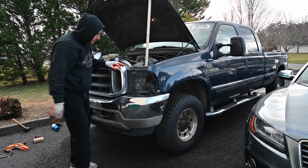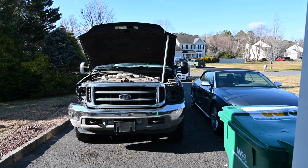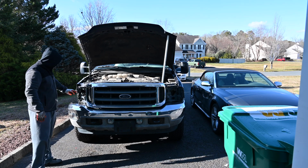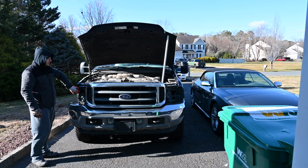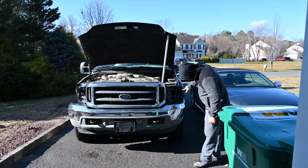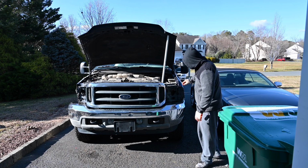And we didn't account for that, but we have 2 weeks to get the part and do what we got to do. So let's start disassembling that now. Alright, so we have to see what we can do here now. So you guys see over here, obviously we have a piece missing. The headlight has a little suction piece that it fits into where it's missing, and also the front of the fender screws into it right here as well. This is where the headlight fits into, and then the fender has one bolt here and one bolt here as well, and we're missing those three things in order to keep all this nice and secure.